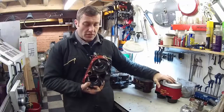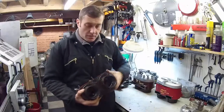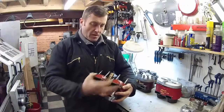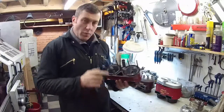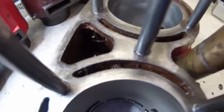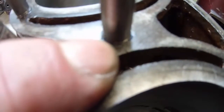These are extremely rare — the reason is that they weren't very good and they all got thrown away or broken. This was basically one of the predecessors of the Scott detachable head. Moving on from the blind head type, this is a detachable head engine. We have quite a short stubby cylinder block. The bottom is exactly the same as the blind head, so completely interchangeable. We have the flat area across the front for the two exhaust ports, the two transfer port openings on the back. On the top we have nine studs — and the problem with these is the centre stud, which is cast onto a very thin web in an X shape. Usually this entire section gets broken off, or if it hasn't been broken off, it's usually damaged. You can see on this one it's actually cracked through that centre thread. They are extremely delicate.